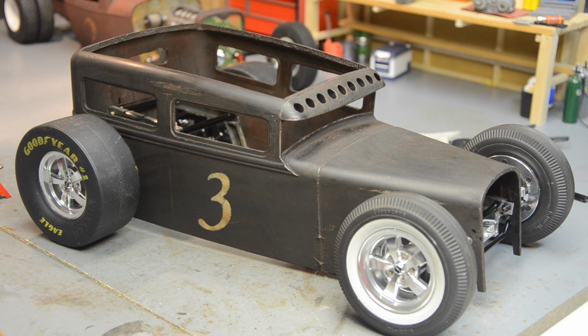But yeah, just a caution to you if you're using heat to help dry your paints on these 3D printed bodies. Don't let it get too hot. I had mine sitting right in front of the heater. I didn't think anything about it. I did that before with the number 2, but that's a different material. That's white flexible nylon stuff from Shapeways, and this I think it's PLA. I'm not 100% sure what material this was printed from. So yeah, just use caution.